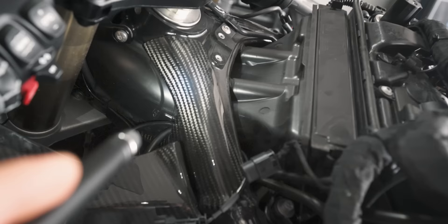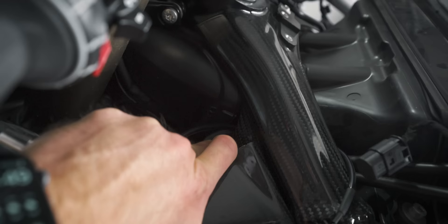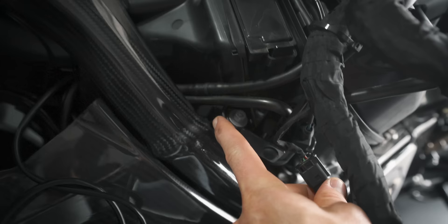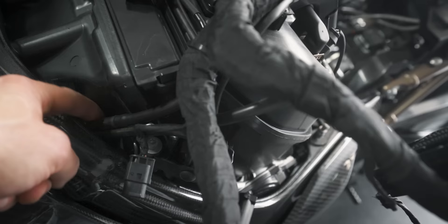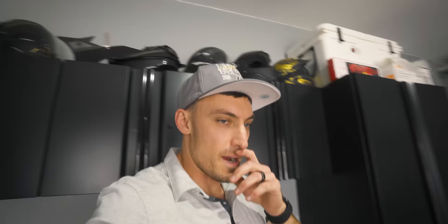Let me show you this while I've got it here — this is where you're going to be putting that cable through, right at the frame. There are two cables right here and you're going to go inside of the frame. If you push them down out of the way and then put the cable on the top, you can barely get that plug through there — it kind of widens just a little bit. I double-checked the video from Bren Tuning and they actually have it going underneath this bolt right here. So I pushed it back down, kind of shoved it with one finger on this side, grabbed it from underneath with the other finger, and then you can put it right through this slot so it comes up just like that. Now to put the cable through the front where it's going to be coming out in the nose of the bike — I'm at least going to have to take off the windscreen and see if I can get it through.